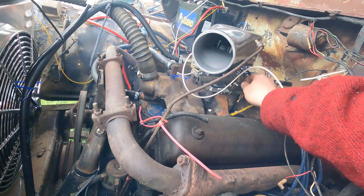Got a cheap Amazon carburetor on it. I pulled this off a different truck that I used for going through the flood when it flooded real bad by my house, just to put on it so rain won't get in it. I ended up having to make a homemade aluminum spacer — let me climb up in there — can you guys see that? I couldn't get any of the fiber spacers tall enough; nobody had them around me, so I ended up going to the scrap yard, getting a half-inch thick piece of aluminum and milling it out with a skill saw.